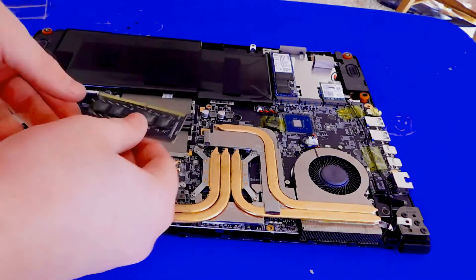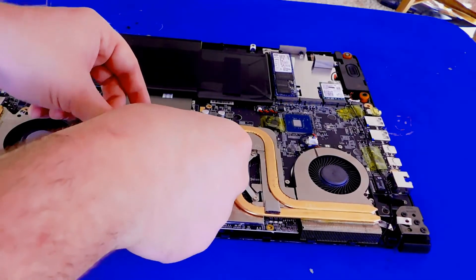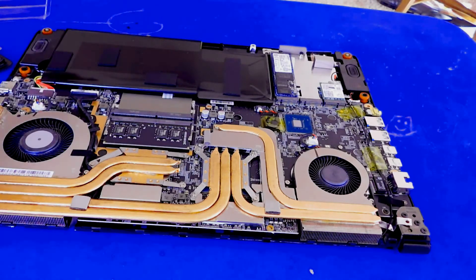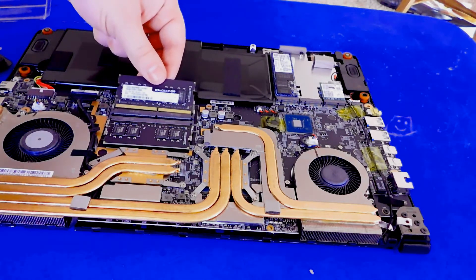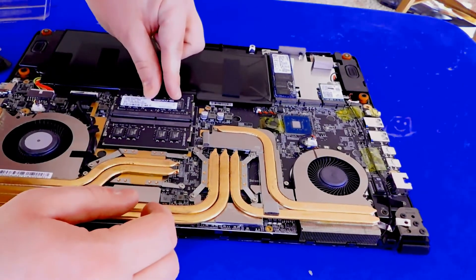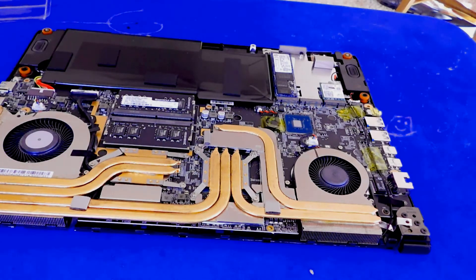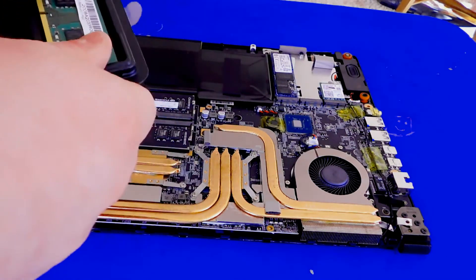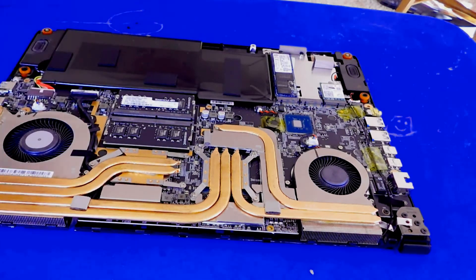You've got to go in at an angle like that, gently push down, and it will click right into place. Now, you may have noticed I didn't unplug the battery, and I've got a really good reason for that. The connector for the battery is very easy to break. So what I did instead was drain the battery of its charge, and once that was done I started making this video. I didn't want to risk getting electrocuted or shorting something out, but I also didn't want to break that connector — it doesn't have a lot of room either. Now that we're done with that, we're going to take our old stick and stick it right there into the packaging, because that's still a good RAM stick.